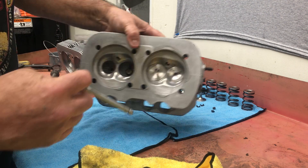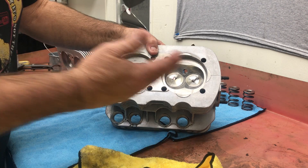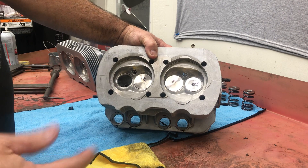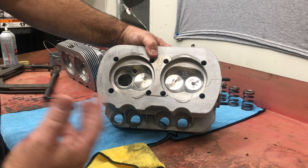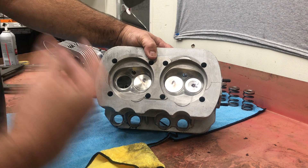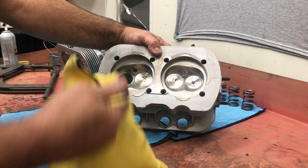Motor oil is your friend. That's what the bearing or whatever part you're putting in is going to depend on for the rest of its life. A lot of guys say it's for break-in and for that initial start. Well, if you prime the motor and you have proper oil pressure, you're good to go. It's not like you can crawl in the motor every morning and lather everything down with assembly lube for startup purposes - that's not a good excuse.